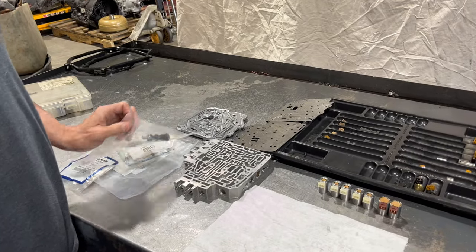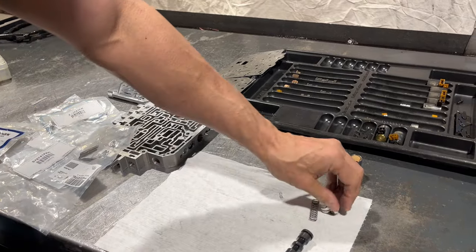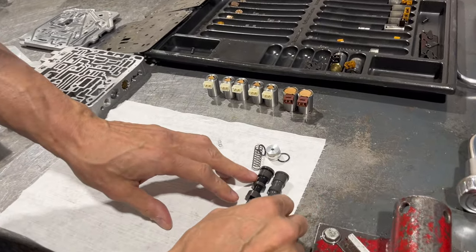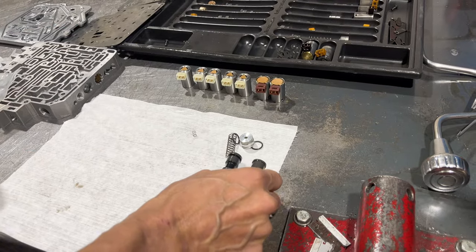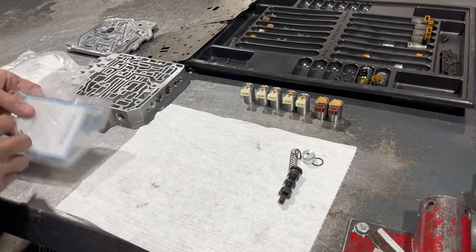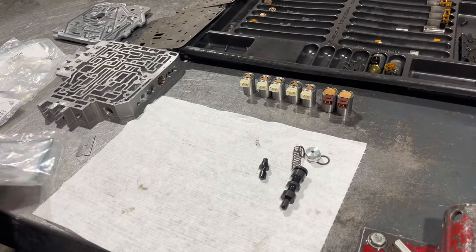All right, so this is some of what needs to go in here. A little pressure regulator valve — all Sonex components. It gives you an end plug with O-rings. This is a slightly bigger diameter than the original one. We're going to have to bore it oversized because the bore wears out. It's akin to cylinder wall wear in your engine — you have to bore it oversized and put an oversized piston. That's all we're doing there. And the same with the solenoid regulator valve — they wear to death and it's going to require boring the valve body out.